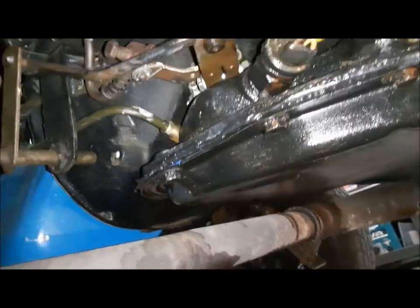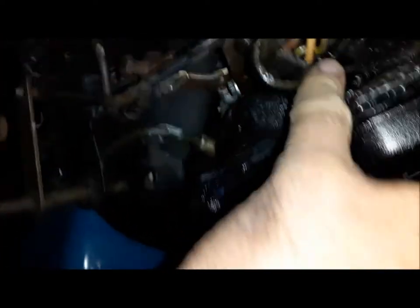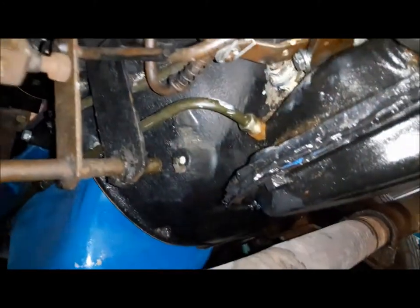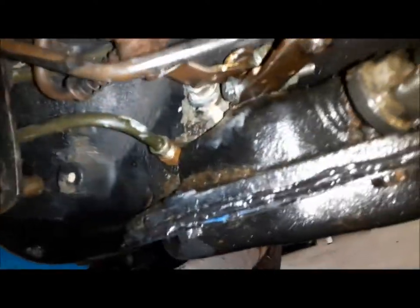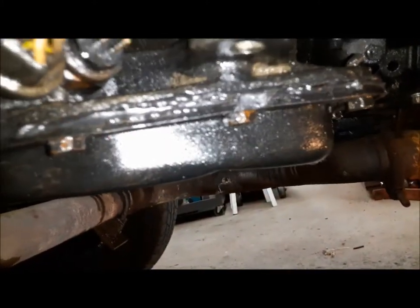Here's the bottom of our transmission — you can see the fluid running off it. Where it's leaking is anybody's guess, but I kind of get a feeling it's the neutral switch here. You can pull that off and they will leak between the cartridge and the case where it's crimped together. They'll also leak from the manual selector seal, and inside that shaft is another shaft which is the kickdown shaft — that seal will leak too. The leak is definitely coming from this side and it runs down and drips all over the floor.